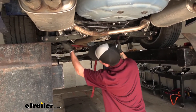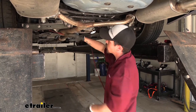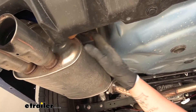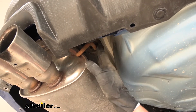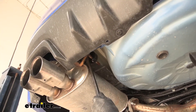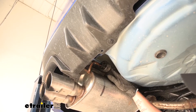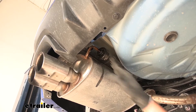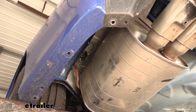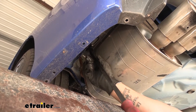Find a solid point to connect to on each side and tighten it up to where there's just a little bit of tension. Then move back towards the mufflers — on each end you'll find one hanger right in the middle. The easiest way to get these off is to apply some spray lubricant and then slide that isolator right off. Take a pry bar and use the muffler to pry against until you can get that isolator to come off one of the posts. It doesn't matter which one, just so long as it becomes disconnected. On the outside of the muffler at the back, we're going to have another isolator — same process. The main goal is just to get that rubber isolator off of one of the posts.